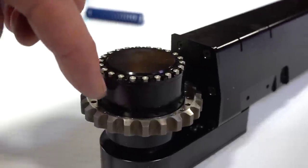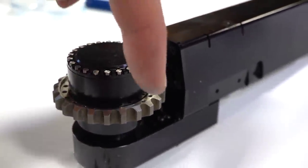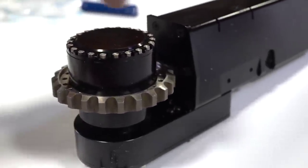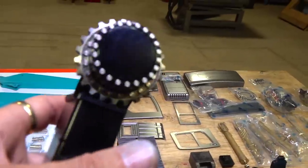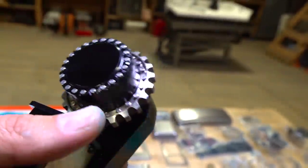Just like any tire, I'm going to do it in a star pattern — start here, then go to the opposite end, then one side, then completely the opposite side. There's no corner in a circle, but you know what I mean — a star pattern. The bolts are thread-locked in on that back sprocket, and there are 30 per sprocket.